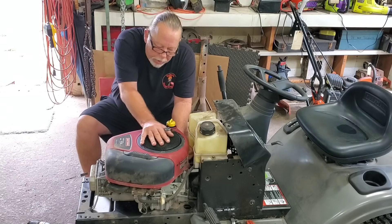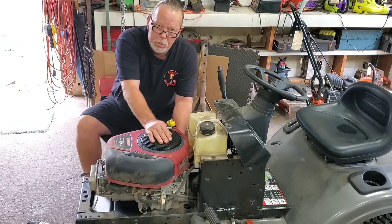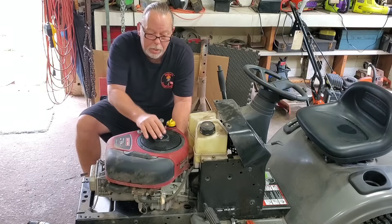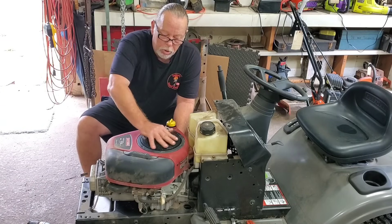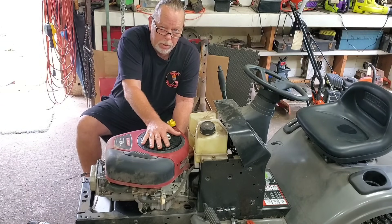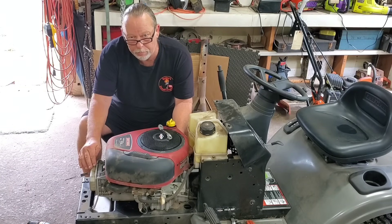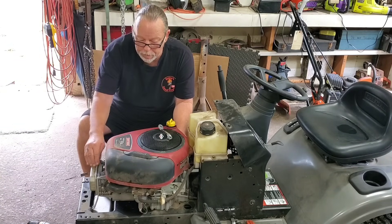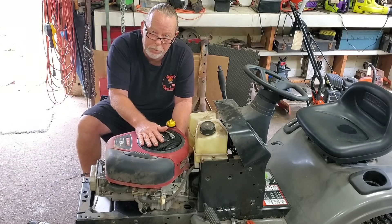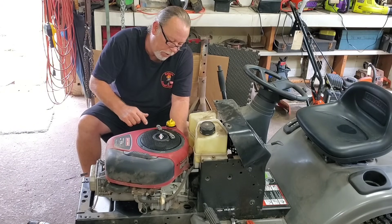This one moved just a little and I could not get it to go past that point. That told me my engine was hydro-locked with fuel — that's what we call it. If it would turn and I could take my hand and get it to go past that point, that would tell me we've got a compression release issue — valve out of adjustment. If the valves are out of adjustment, the compression release won't work and you might have a bad camshaft. I've got a video on that — I'll put that link in the description.